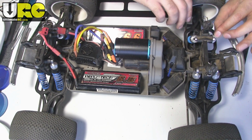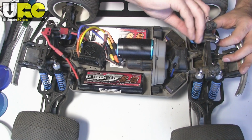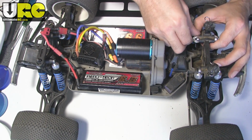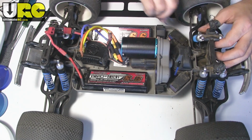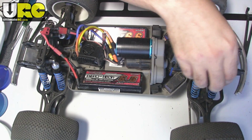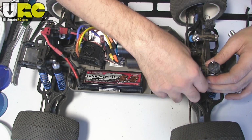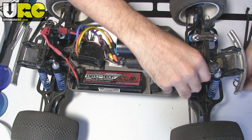I've got one of those little 1/16 inch spacers on the front, on all these shocks on the front. I'm going to take those out and run just a little bit less preload in the front than I was originally planning on, because with the shocks rebuilt, everything is running a little bit freer in there. Things are looking just a little bit higher than I expected.